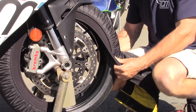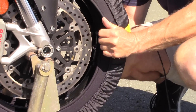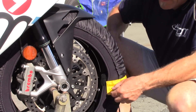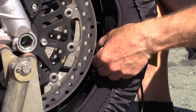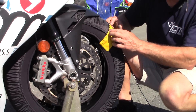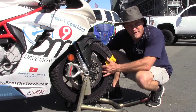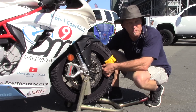So that's done. Why do I do that? Well, where's my valve? It's right here, right by the joint. So when I want to check pressure, I can do it here really quickly. I don't have to spin the wheel around, and our control unit here won't go past the fender. So putting that on above or below the valve, depending on where it is on your wheel, is going to be extremely helpful in making sure you can check pressure easily.